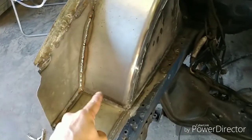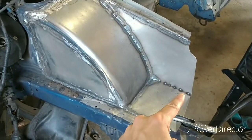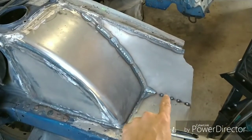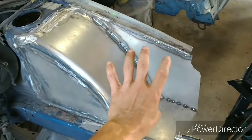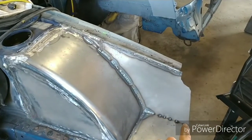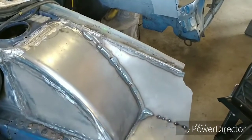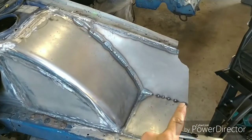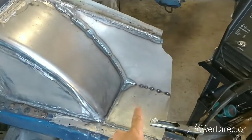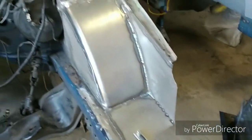After it's all stitched up, everything is solid all the way around. I've gone ahead and put in the other pan and got it all tacked in. I left all the tacks here just to give a demonstration — these tacks are your little fingers that are going to hold it there and provide the structure you're looking for. The reason you tack it in place is for metal distortion. Once you tack here and then tack here, it's able to distort in between the tacks. If you just started running a stitch all the way down, the whole panel will get wavy, the bottom pan will dome and crinkle. You're looking for nice straight pans.